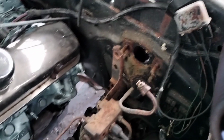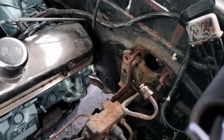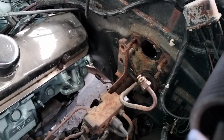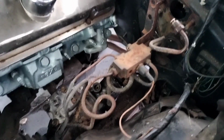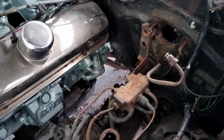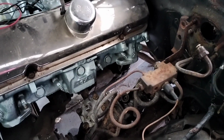Well, got the master cylinder off too to get it out of the way, because we're going to be putting a power brake booster back on the car, because this, in its hot rod phase, was converted from automatic and power disc brakes and power steering. It was converted to manual steering and manual disc brakes and a 4-speed. So there's also a little boot bracket under there I need to get off that's from the old 4-speed conversion. And once the booster's on, I'll have to build or source a couple brake lines, one of them that was cut up because there was a line lock on the car for the track. So I just need to snug up the steering column, little rag joint, and then probably get the header back on, I guess.